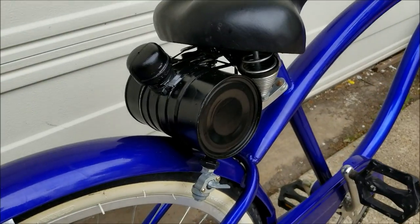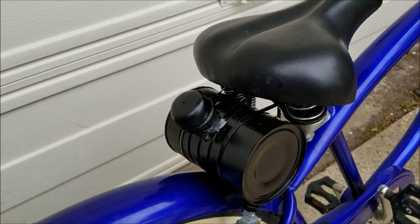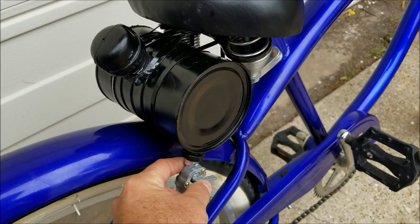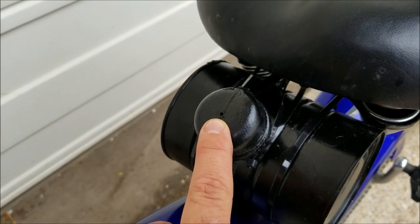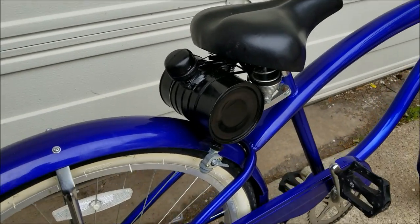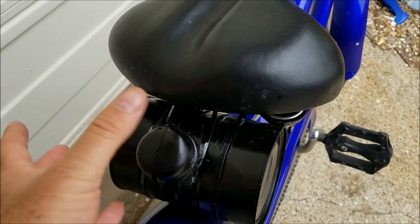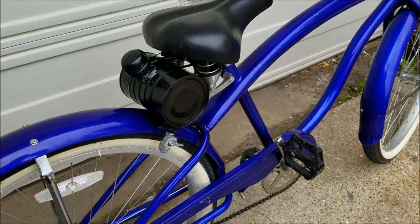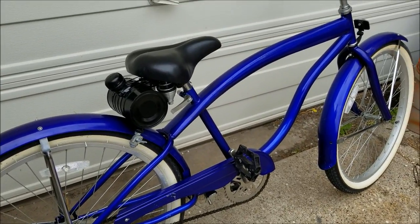This tank design could work for any type of small engine — just get a bigger can for a larger engine. The benefit of this can was that it was sealed on both ends, so I only had to solder the mouthpiece and the petcock hole. The 5/64ths vent hole worked out well — gas flows out nicely. You could also orient the can the normal way with the fill spout on top and the petcock at the bottom, depending on your setup. I did it this way for a motorized bicycle, but it could work on any small engine. Thanks for watching.